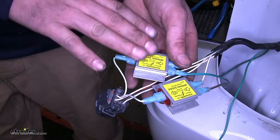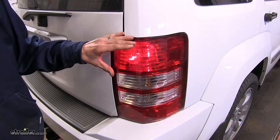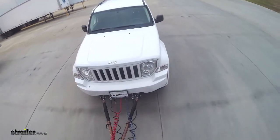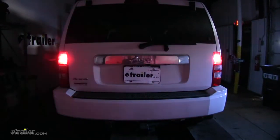By utilizing this diode wiring, we don't have to worry about using magnetic tow lights. We utilize what our vehicle already has in place from the factory, so we only have to make a simple connection at the front when we're ready to flat tow. The diodes will prevent voltage from the motorhome being backfed into our Liberty's expensive electrical components, potentially causing damage. They only allow electricity to flow one direction, so when we're hooked up to our motorhome, our lights work properly, and when we unhook and we're driving about town, our vehicle's factory lights are working just like they would normally.